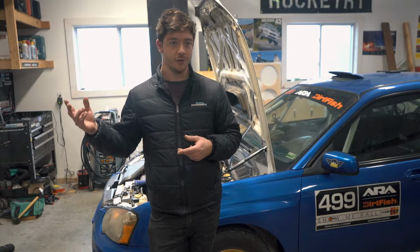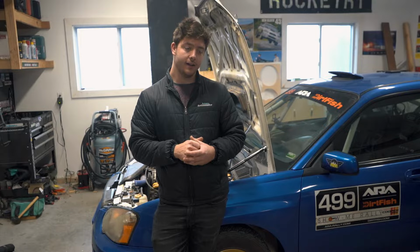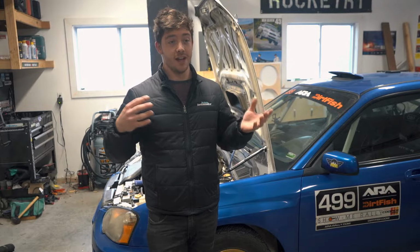And so I built the roll cage myself. I learned how to weld in high school, but I'm not a welder. I'm a carpenter. I build stairs. But putting together a roll cage isn't that different from finished carpentry in that everything has to be really precise and exact. But I knew I wasn't going to be able to bend the tubes myself. So I found out that there are kits available. Broken Motorsports in New Jersey makes a really good kit, and that's what I used. They're a small-time rally company, and it all comes pre-bent, and you still have to fit and notch the whole thing though.